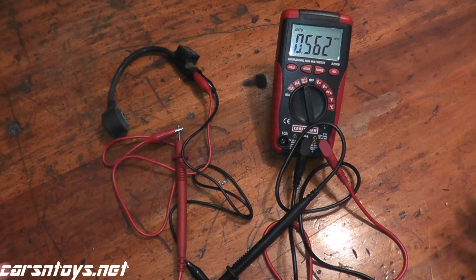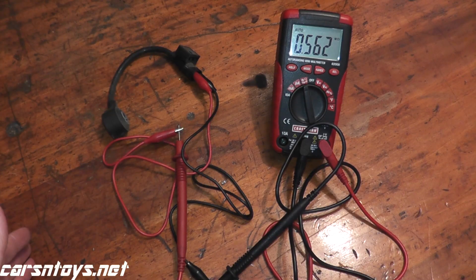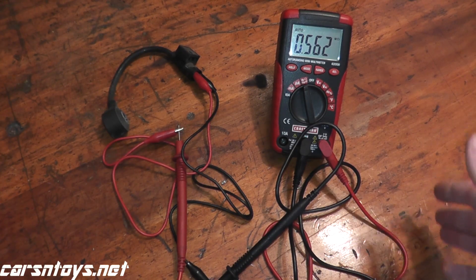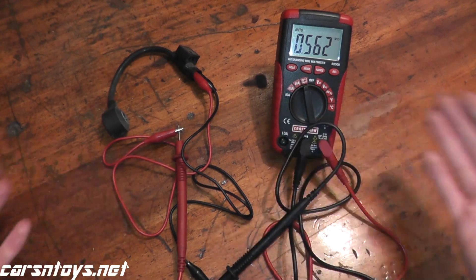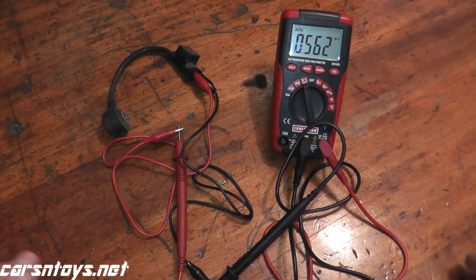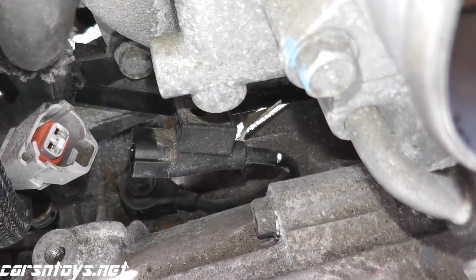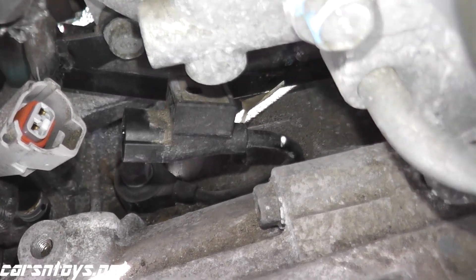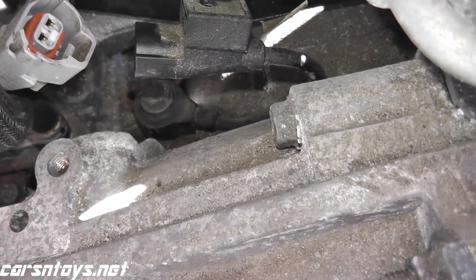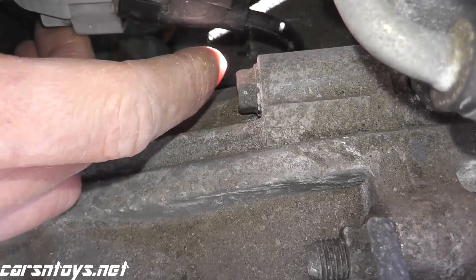For this specific vehicle, a good range is between 500 to 600 kilo ohms. Subaru recommends replacing the sensor if it drops below 500 or goes above 600. On most vehicles, if you're not getting a reading, or it's very low or very high, that's a strong indication the sensor needs to be replaced. When you reinstall the sensor, keep it in the same orientation as the old one. Use a magnet to get the bolt in, tighten it down, reconnect the sensor, and put everything back together.